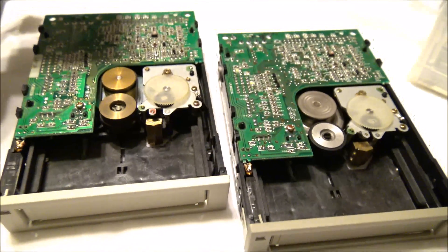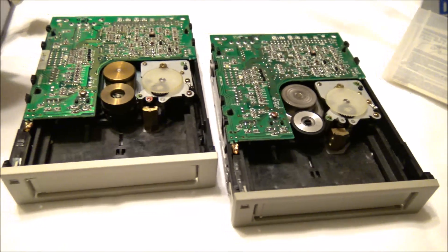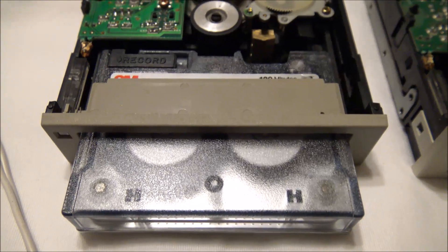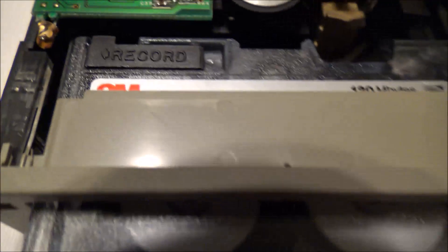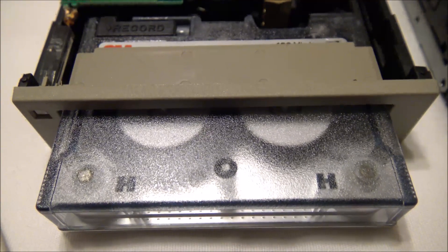These are really cool — they were made in the mid-90s and are very efficient in operation and quiet, which is why I'm placing the microphones up close so you can hear them moving along. You may hear some buzzing in one of your speakers, and that is normal for this demonstration. Here you can see what the tape looks like inserted into the front of the system. There is a status LED on the left side, which is actually way back on the circuit board and shines through a fiber-optic-type plastic piece all the way to the front. I'm going to remove the front bezel so you can see the tape reels moving inside. Another interesting feature is the record protector — by switching that little switch to the right, you can write-protect your cartridge so it doesn't get overwritten. Alright, let's remove the front bezel and see it in action.